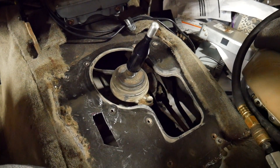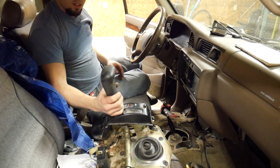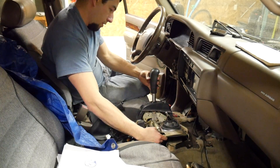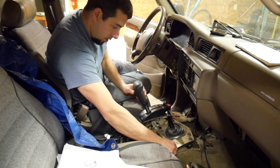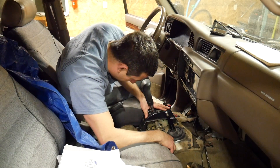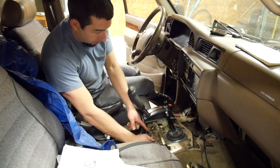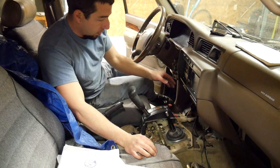I've got my hole crudely cut. Not too happy with the way it came out, but it fits and it will serve its purpose. Let's test fit this shifter. We've got to fit this shift linkage in first — the shift arm. Takes a little bit of finagling, harness is in the way. I think it fits pretty good — it's lined up right there, there's full range. So I don't need to trim anything else. Now I just need to seal up the holes I have left and make the arm attached to both the transmission and the shifter.